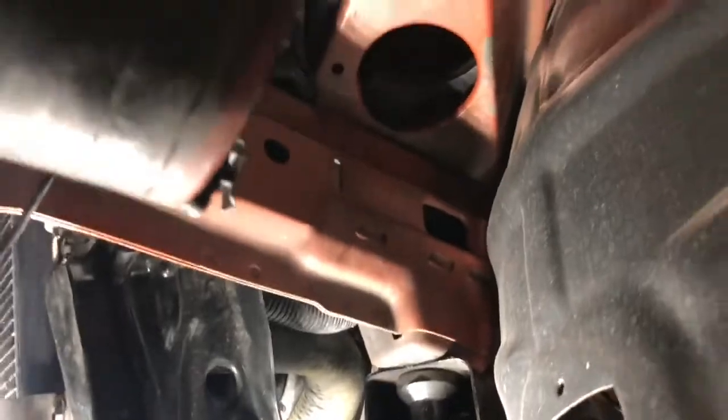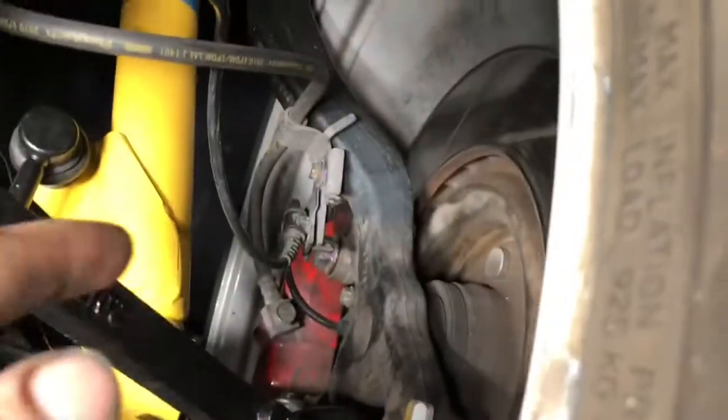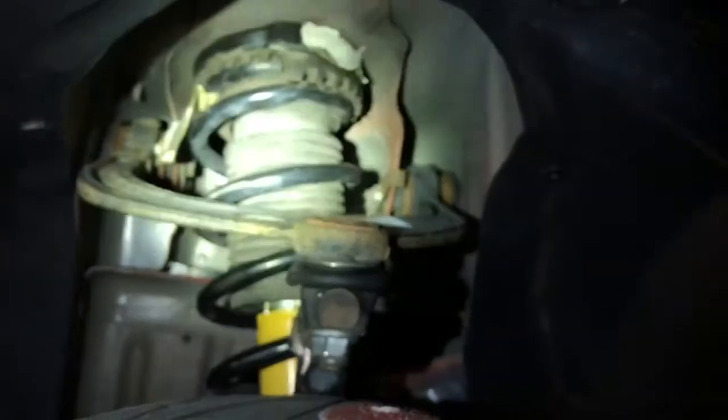So now we can see a little better. This is the side that was hit. So I got new control arms, new shock absorbers, even the spindle has been replaced. All new tie rod ends, all the links - all that stuff. I even have the parts for the other side in case you want to replace those as well. Just a quick look up here at the inner fender - it seems to mount perfectly. I don't see any signs of any frame pieces or parts of the unibody that have been twisted or shifted. That looks all good, because this is the side that got the biggest hit.